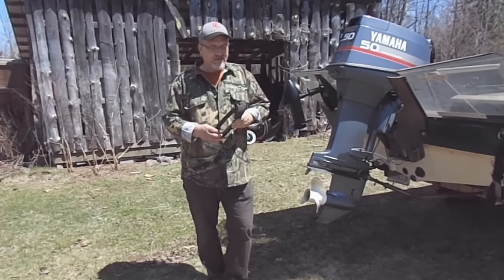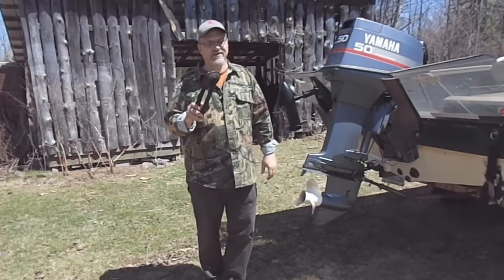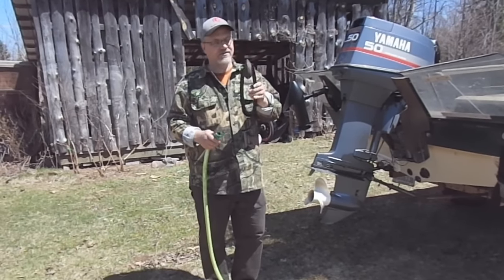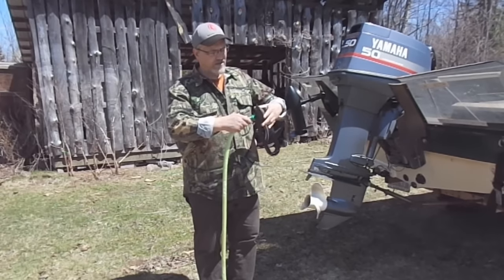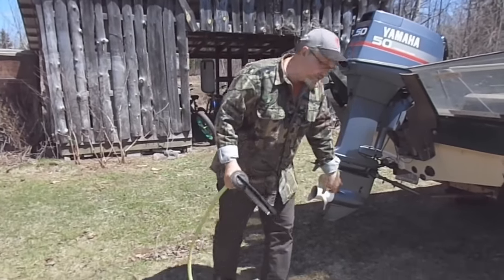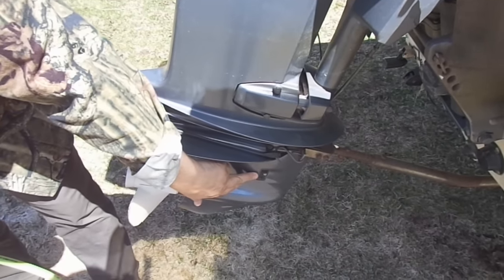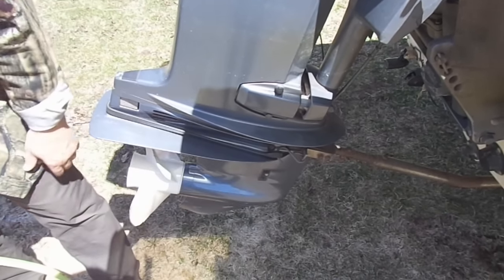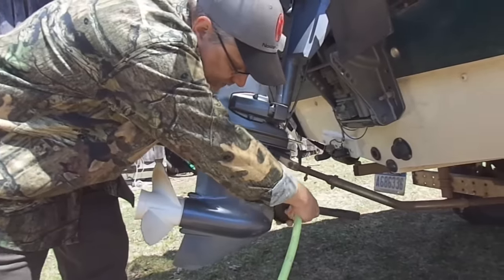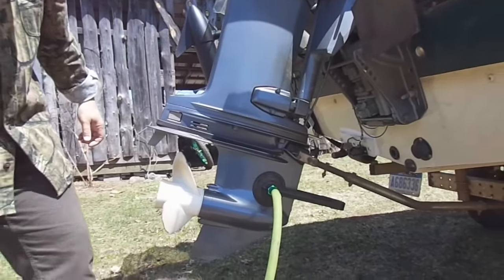So how do you do that? The easiest way is one of these outboard motor hose adapter muffs. All you do is take a garden hose — this is a super inexpensive set, I think it was like $4 — and you screw it onto the garden hose. Then you find where your intake is on your boat motor; it's right here on this one. That's where the motor sucks water out of the lake up into the engine to cool it down. You just slide it over — there's usually one on either side — and then you turn the water on.